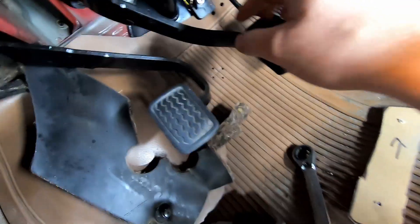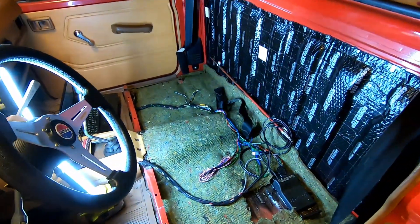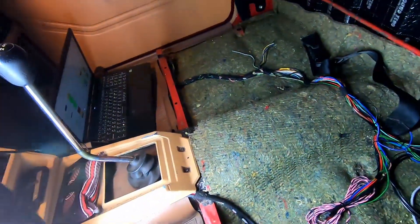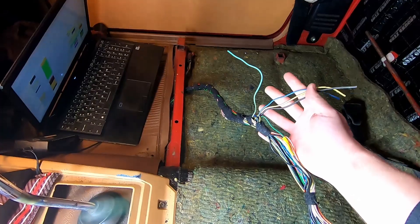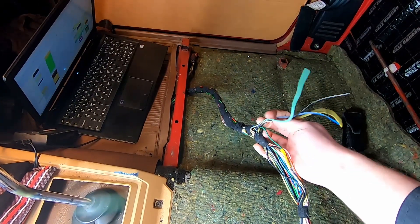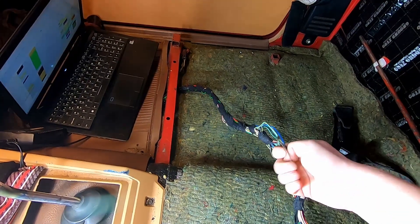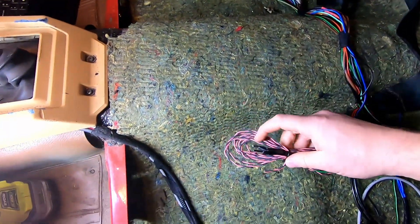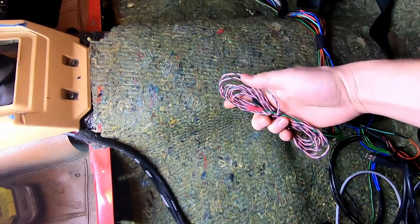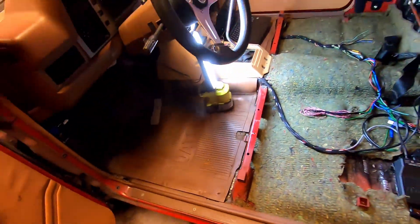Until I get the spacers sorted, I'm just going to start with the wiring. Now that I've removed the carpet you can see the wiring harness going to the ECU and the engine. There are some unused wires here which I'm hoping we'll be able to use for the electronic throttle body. Down here you can see the rest of my flying lead harness — we'll be using some of these inputs to connect to the pedal.